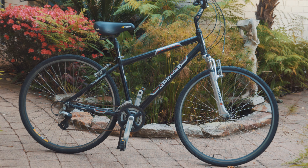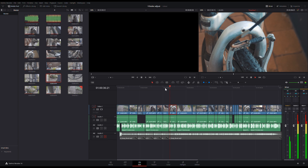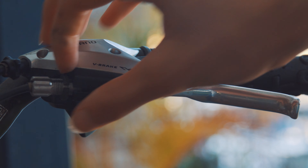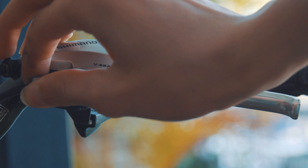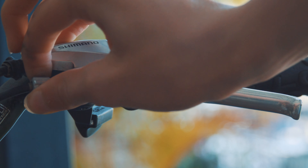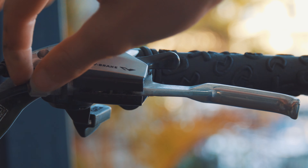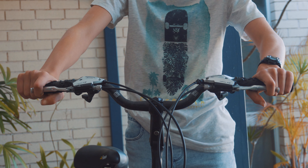Lastly, at the start of the video I said so long as it's in the general range, it's fine for now — we'll make it perfect later. Up at the lever is what's called a barrel adjuster. Turning it will adjust the tension of the cable, and thus the feel of the lever. Play around with this until it feels good. Do the same with the other lever so they both feel equal.